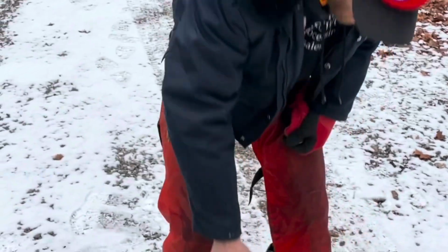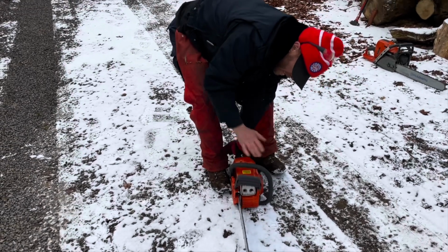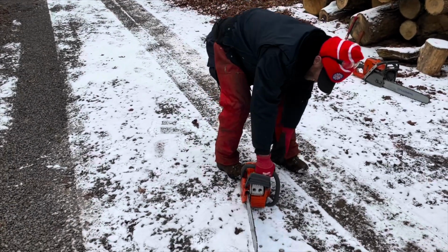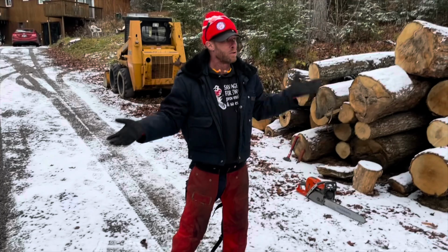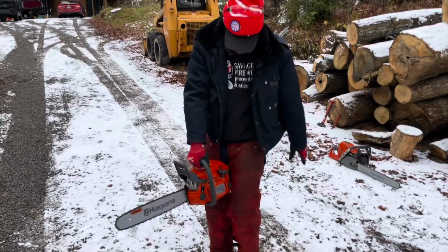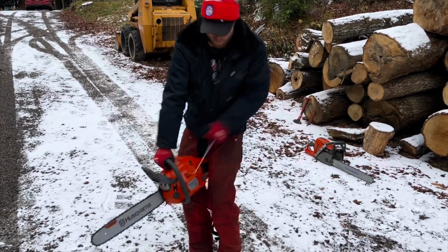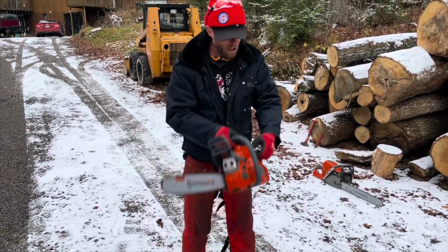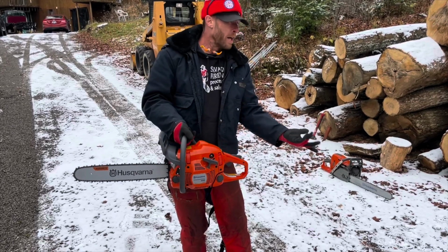And what we'll do is put it on the ground. Safety brake is on. Now, I don't fire a saw this way. Ideally, they want you to put your foot on the ground and fire it up this way. It's positive control. Whatever way you do it, I'm going to tell you this way, positive control of the saw. I'm going to do it this way, between your legs, your hand firmly here. Another option is to let the weight of the saw pull away from you as you hold this. See, hear it kick, regular mode.